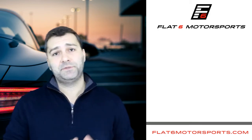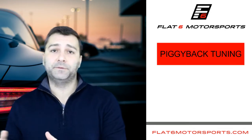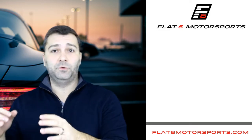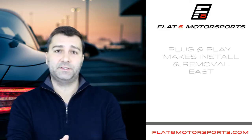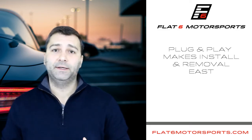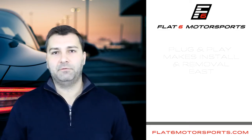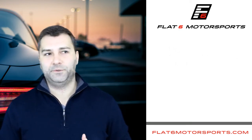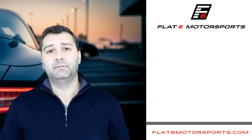Now let's talk about piggyback tuning. The nice piece of piggyback tuning is, if you can remove it — it's plug and play. It's an external computer that hooks into the existing sensors, but you can also unplug it and it's like it was never there. You'll never see an event on the ECU, so it would be very hard for a dealer to understand that anything was ever done. That's basically the main benefit of a piggyback.